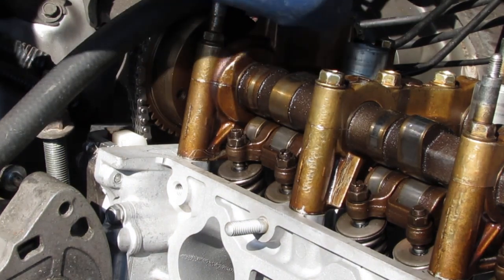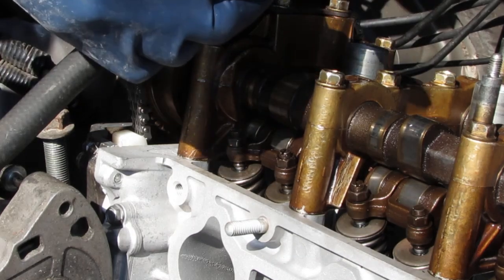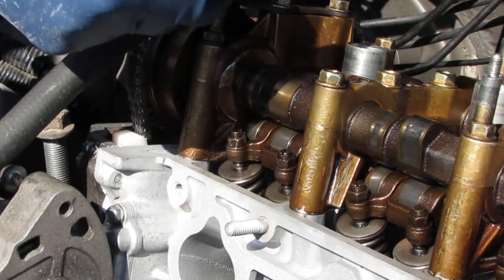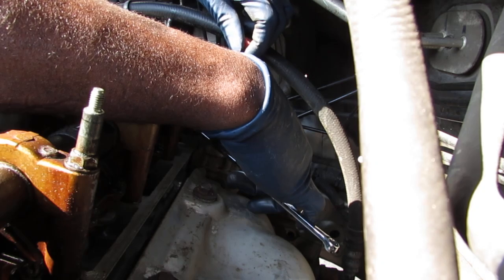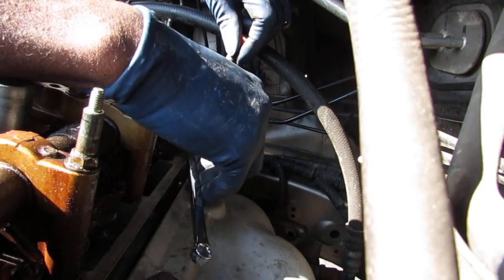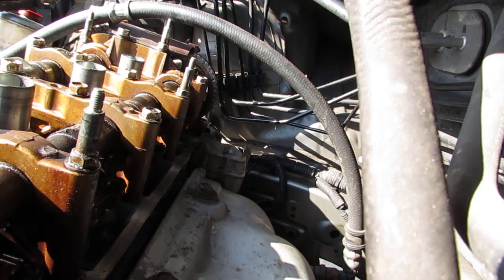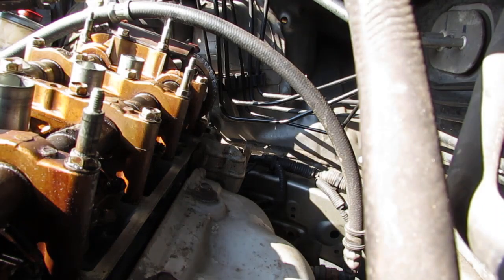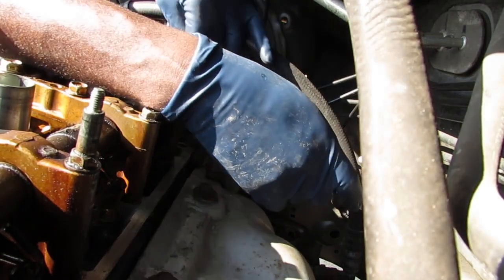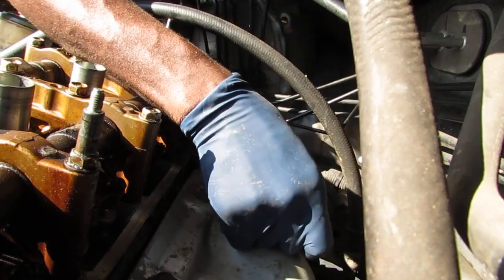You know what? Even better, let's go to the exhaust side. So the exhaust side, right? It's going to be 12 thousandths of an inch, or 0.30 millimeters. So 3/10 of a millimeter. Tighten that up, there you go. Double check. Perfect. And we're going to torque this down to 13 newton meters. There you go. That's it.